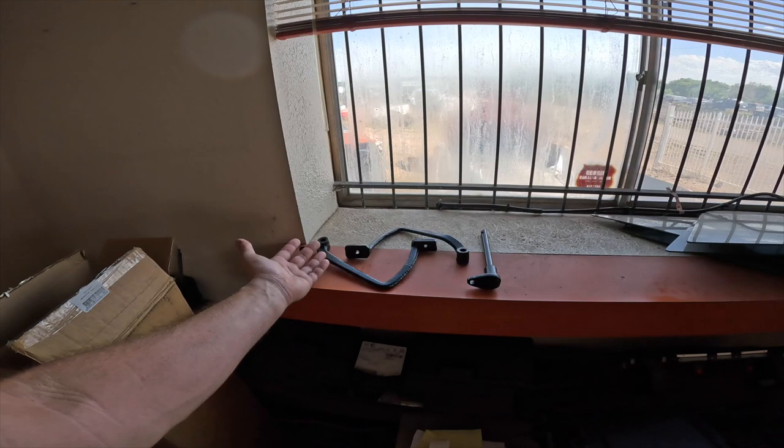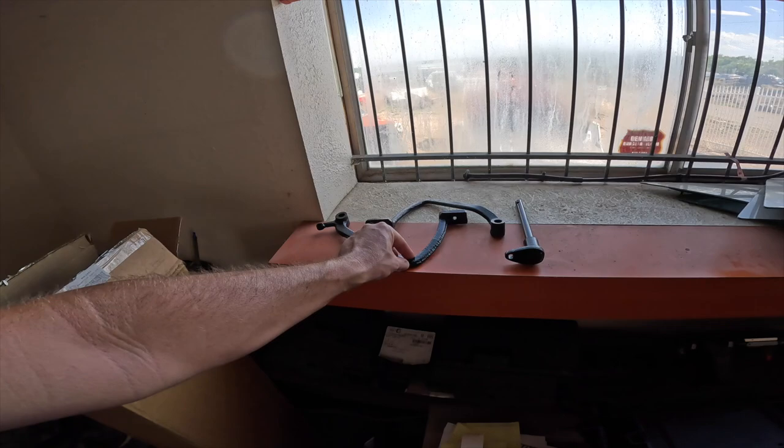After a bunch of blasting and coating and spraying and doing all kinds of stuff, applying stickers, we have a bunch of parts done for the Keller, and I think they came out amazing. So the first thing that I think is awesome is I finally got the pedals apart. I fixed a few things on them. There was some casting that was really sharp when you ran your finger across it. I hit it with a file to knock that down. I also coated the pin.